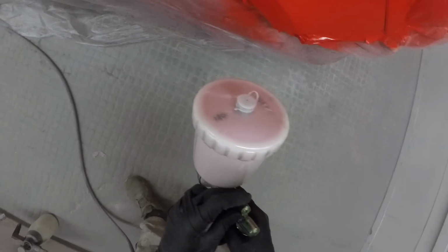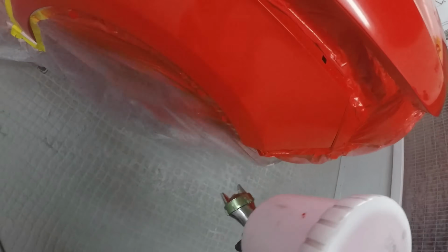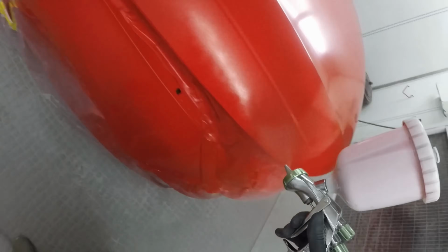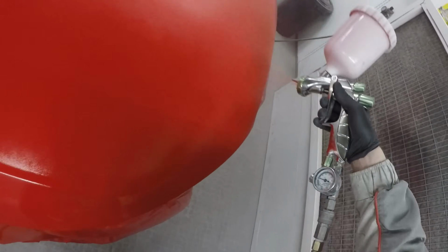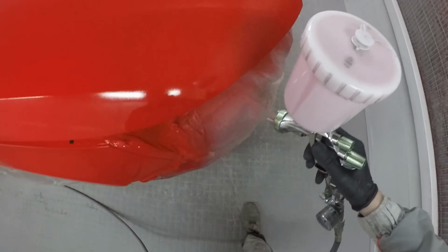And as I've been going, I have been gently flicking out part of this colour, just to give it that slight blend, because this is one of them colours that I did actually have matched. I didn't just go for standard shade, I did get it matched just to be on the safe side. With it being a 3-stage pearl, I wanted to make sure that the paint that I was putting down was as close to what is on the car as possible before we actually started to worry about trying to go excessively far with blends and that sort of thing.